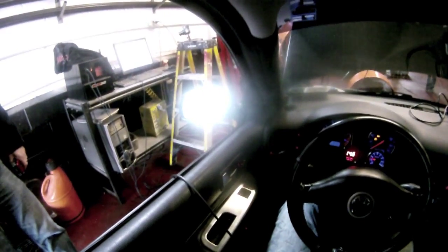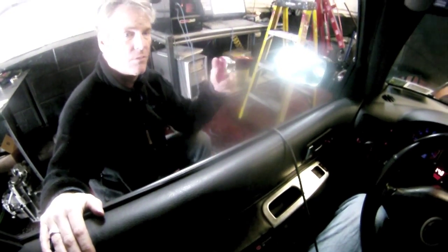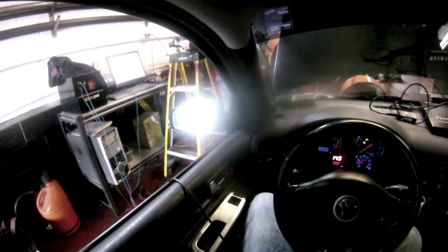This thing will probably be able to pick up torque a lot harder. It's at 21 degrees at 7600 RPMs. This thing is also on the stock exhaust manifold — not a high-flow. It's making the same power. For a regular car this setup would probably be ideal. 550s are probably necessary because the injectors are having a hard time up to 7000. With the water-meth I should be okay.